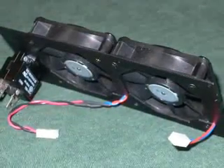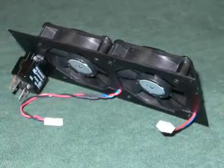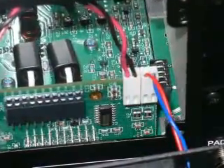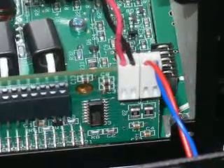The two fans come with different length power leads — make sure yours looks like the one in this photo. Now plug the fans into the main control board and follow the manual to test that they work OK. You'll be powering up the K3 again for this test.